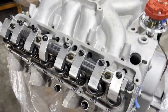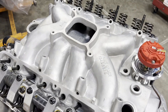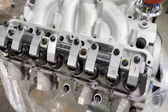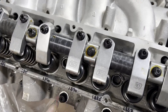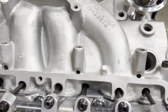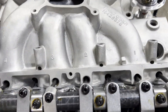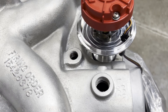Morning guys, it's Brent with Likens Motorsports. We're mocking up our freshly vapor-blasted intake on our 482 all-aluminum tunnel port FE motor. Right now I'm just double-checking all of our pushrod clearances. The way you do that is you mock everything up — I've got bolts in all four corners to hold this down, our distributor is in and it's centered.